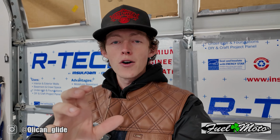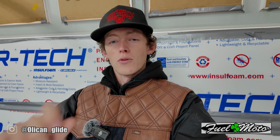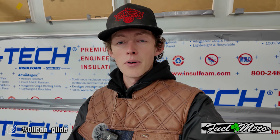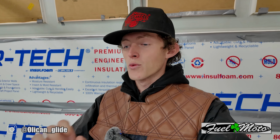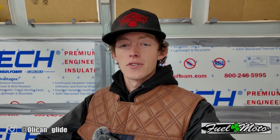Many people don't know, but the right way to dyno tune a V-twin is to have your sniffers like 3 inches from your exhaust ports. Some dyno tuners out there just put a sniffer in the end of the pipe and specifically on 2-into-1 exhausts. That's not the best way to do it. So Fuel Moto has addressed that by putting 18 millimeter bungs in there, easy for dyno tuning.